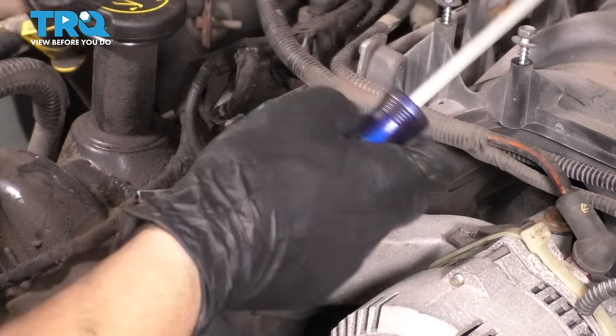So that was the first pass at 90 degrees. And now let's do a second pass at 90 degrees. And this is where it gets tough, because one, it's not going to be easy, and two, it's going to be a little nerve-wracking hearing those bolts creaking. That's why it's important to lubricate them. You want to overcome that friction. You don't want any broken bolts here. And obviously, same sequence. Here we go, second pass at 90 degrees.